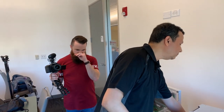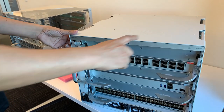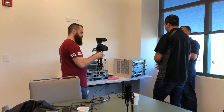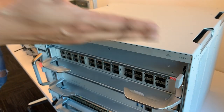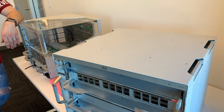How does a company that designs cars help design a switch? Some of their inputs couldn't be executed in practice, but some cool things they helped with were the curvature and folds of the sheet metal. If you look at legacy chassis like the 6500, the sheet metal plates are riveted together with square edges. On this chassis, if you look at the front, there are no rivets — that's a cool feature. Earlier, you would have had rivets all over to ensure mechanical stability.